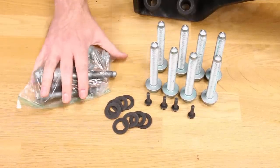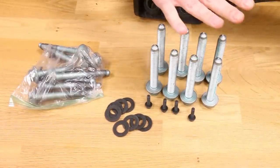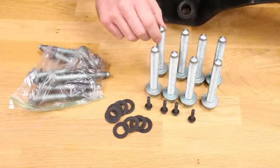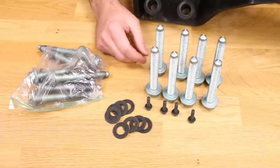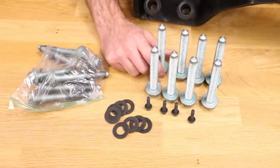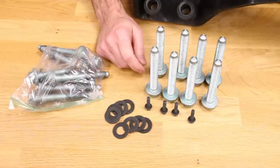Here's the hardware that was included with our hitch from the guys at Wolf. I'm not going to be reusing it. As per VW, they recommend not reusing these bumper bolts. So we will be doing this new hardware kit, which we will link to as well. If you were doing one of these hitches, you would probably want to install new hardware, especially being that we're approaching the towing capacity of this thing.